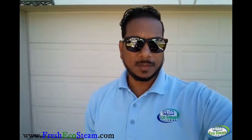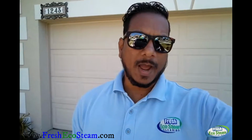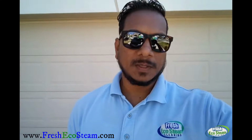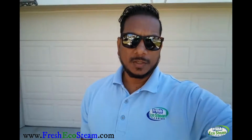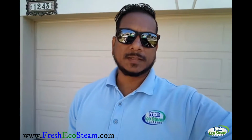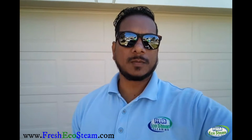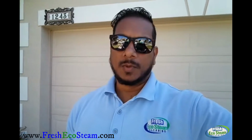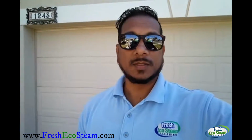So after demonstrating, you can obviously hear the difference in the roughness, the texture of the paint. You can't actually touch the car because I'm the one doing it, but trust me, it feels smooth like glass. And why is this important? It's very important because once you put on your sealant, it will stay on the car longer. Certain waxes and sealants last a certain amount of time on the vehicle, depending on whether it's garage kept or outside as a daily driver, and how it's washed. But the first step in keeping the paint protected is to get the car clayed. That's why it's very important to get it clayed.